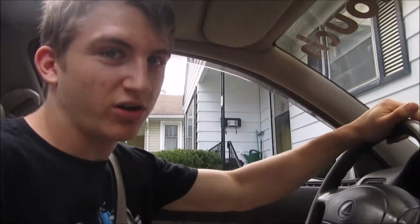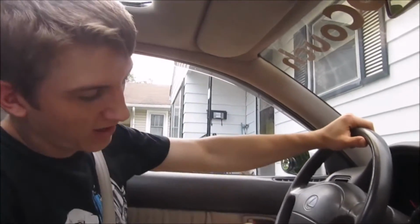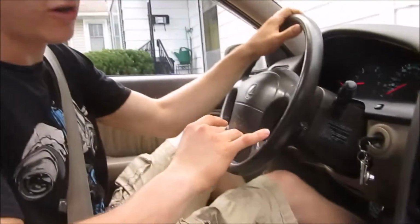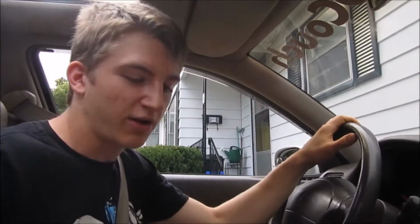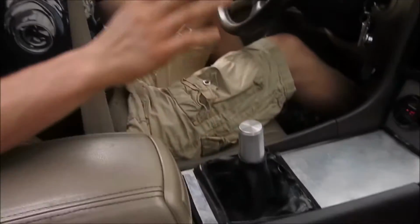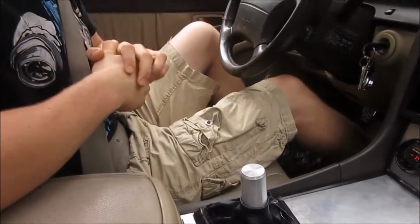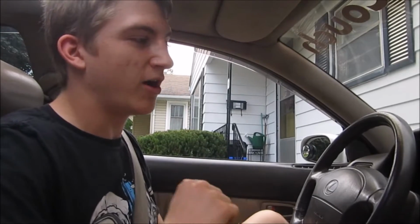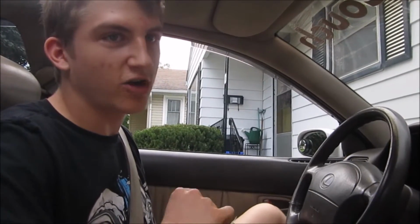Now once we get some oil pressure here, I'll start her up. As you noticed, I didn't start the car with a clutch, which is important for this car because oil pressure is low, and with a manual conversion it puts a lot of pressure on the crank, and not putting the clutch in before starting the car helps a lot with the crank walk issue, which is very common for our cars.